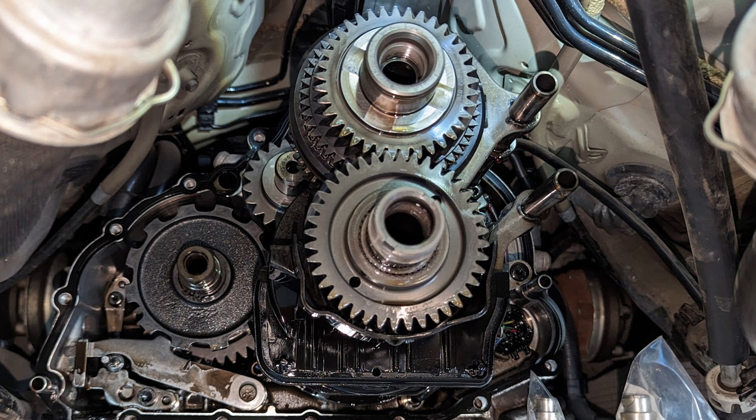Unlike the 981 or 987 platform, there are a number of different variations of this transmission and how it's installed inside the car. There is either a two-wheel drive or four-wheel drive version, and also depending on if it's a 991 or a 997 it will come either with or without the gear oil cooler. If it has the gear oil cooler, the procedure for removing that is exactly the same as the 981, which is in the linked video.